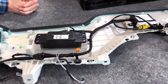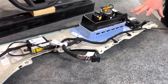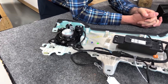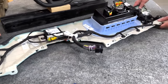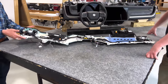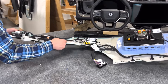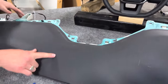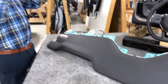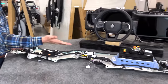It's a little interesting to see it on the underside of the IP top cover - typically it's in the engine bay, but it's an example of packaging something somewhere by using space that is otherwise not available. Normally the top pad would have the passenger airbag for sure, possibly speakers, and maybe welded ducts. They don't have welded ducts here, but they've managed to package all these other components. As long as their assembly process allows access to all the connectors it's a good idea, though it does make the part somewhat unstable. There's a lot of weight on that side - it's pretty flimsy, kind of like a bacon strip. You can't pick it up from one end without it flopping, and you can see it's been creased from twisting and turning.